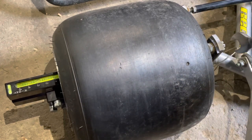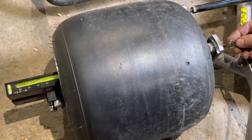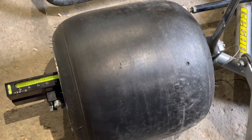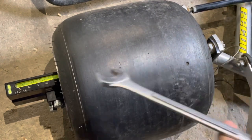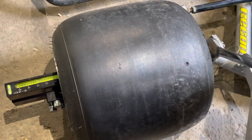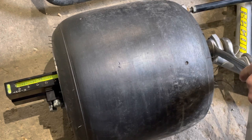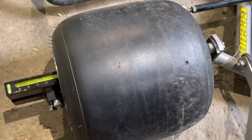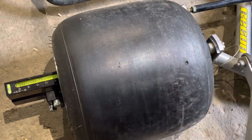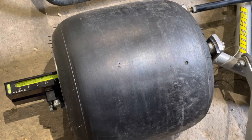Pay attention — there is a hole here for your safety clip to go through so that it doesn't rotate on you and doesn't come apart while you're racing. If you're paying attention over on this side, you can see that bubble is more nearing the two and a half mark — right about there. You're going to get both nuts on there and then tighten. That will stay about there. Basically, that's all I do for a camber adjustment. Real simple. Do this on scales — I have it on the ground just because I don't want to set up the cart scales right now.